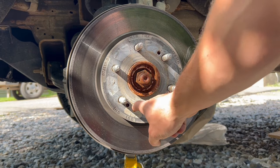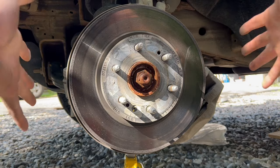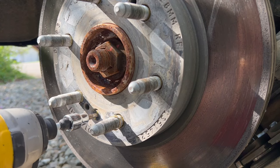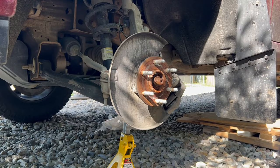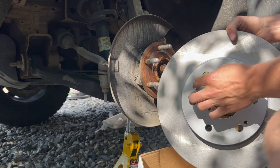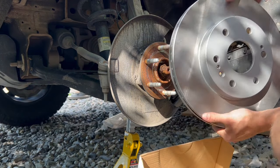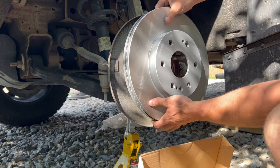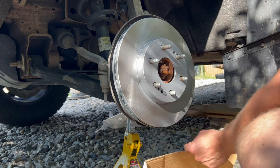In order to get this rotor off, you need to take this hex bolt out. Once you get that hex bolt out, the whole rotor will slide right off. When you put the new one on, you want the hole to line up with where you took the hex screw out — if you don't, you're not going to be able to position it on. So just make sure that those line up, and then you can go ahead and put that hex screw right back on.